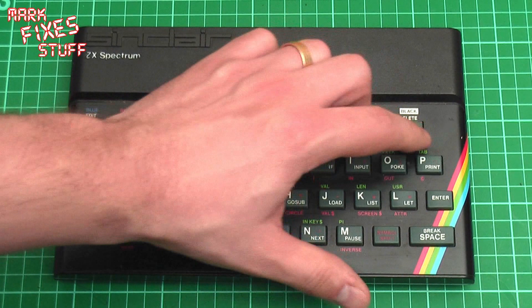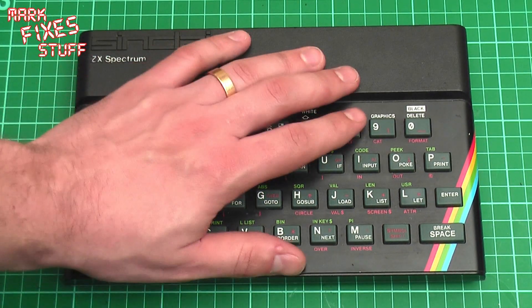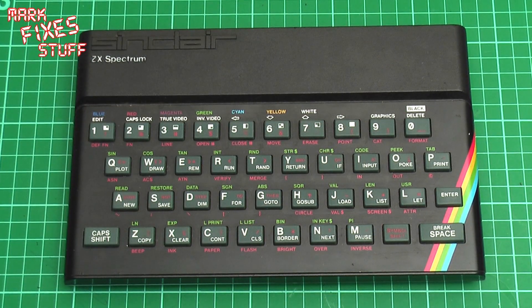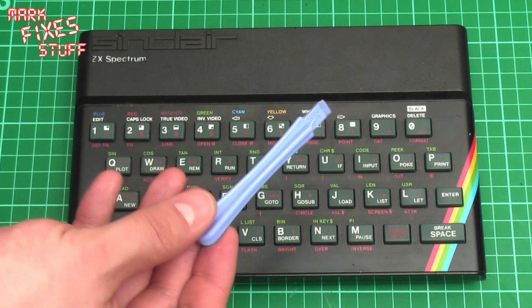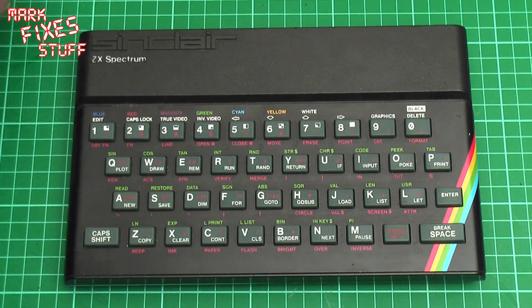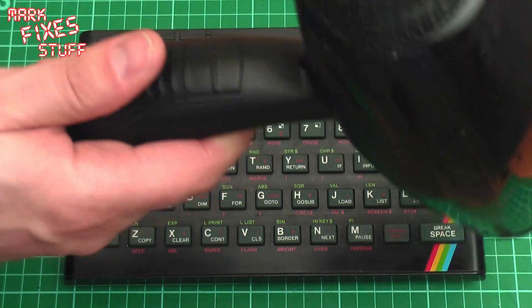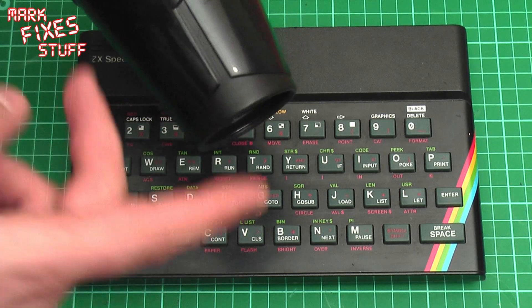This one's got a couple of little dints but nothing major, so we'd like to keep it as cosmetically perfect as possible. The first thing we need to do in order to change the membrane is get this faceplate off - it's really, really important that it's removed. We need a mobile phone opening tool, or a prise - they're made of soft plastic so they don't scratch too much. We'll also need some source of heat, and I wouldn't recommend anything hotter than a hair dryer.